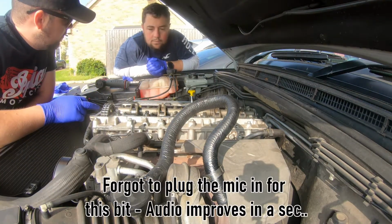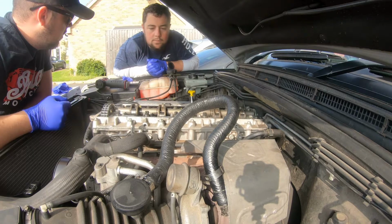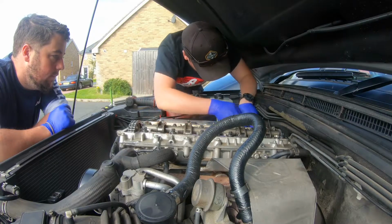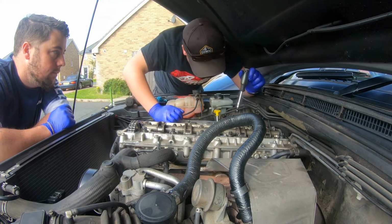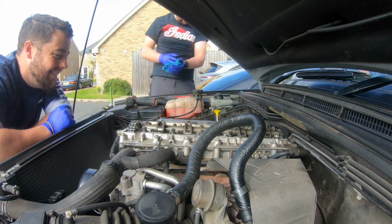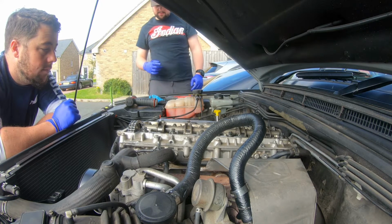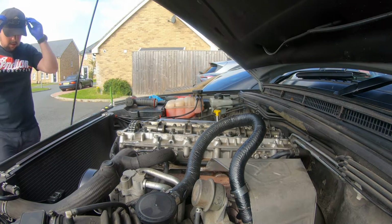If I prime the fuel system, you can look down in between and see which ones it's leaking out of. You should see a little bead of fuel leaking out in between the injector and its seat. Come on. Lift off. Not much fuel, because most of it's in the oil. It's leaked out already. So that's off, that's draining the fuel off into that tray. So now we just take the rocker shaft bolts out. And then we can use your ratchet for that.